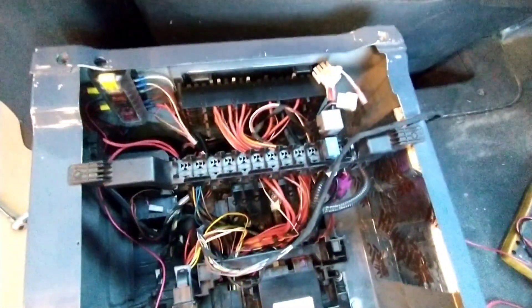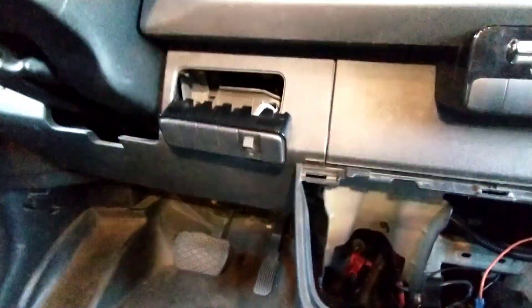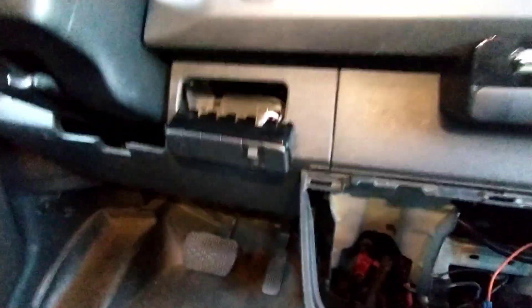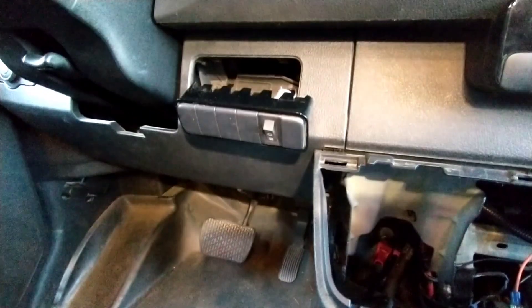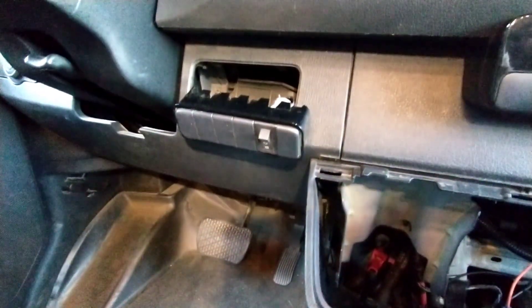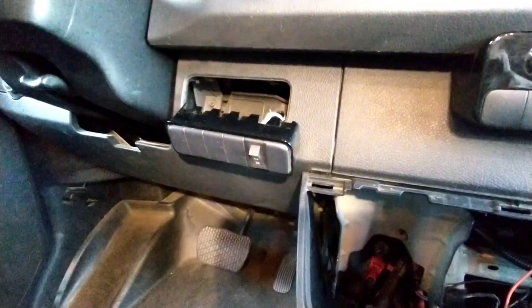Everything's back together. I'm getting ready to plug the airbag back in. I've tested my switch and it does work as advertised — doing 12 volts in the back. There's no load on those trigger wires that I'm aware of, so the diode should be fine for the current-limiting function of the DC to DC. I'll record when I get done back there and it's about ready to hook up and start a test.